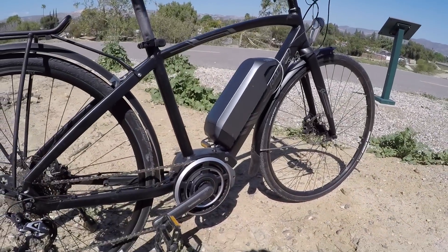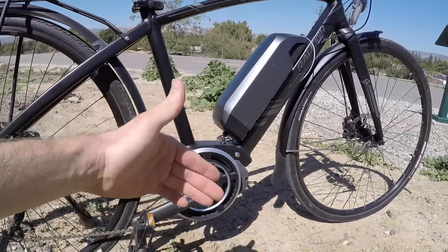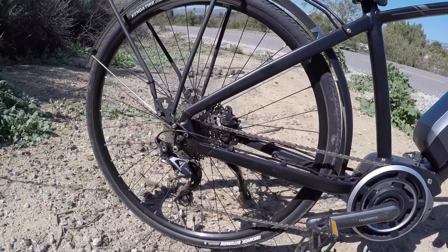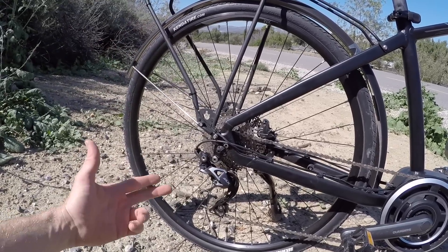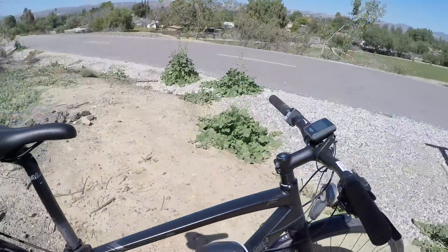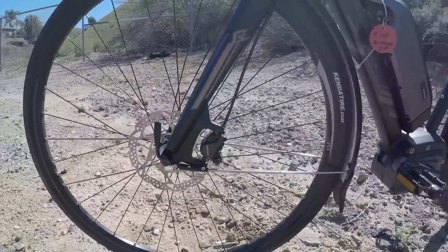For those used to multiple front chain rings on an electric bike, that adds complexity, weight, and potentially more force on a mid-drive. Ten speeds is great, and I see that on a wide range of quality bikes. This year Yamaha is introducing two front sprockets, but that's just one more thing that can go out of true, plus a second derailleur and added force. The trigger shifters are Shimano SLX with a gear indicator window. The brakes are hydraulic Shimano disc brakes — I think M445 — with 160 millimeter rotors front and rear. They work great; you don't have to squeeze very hard.